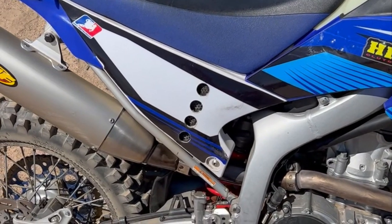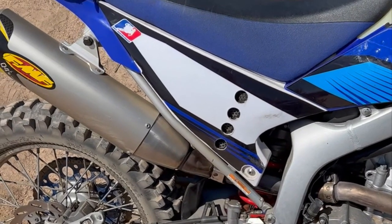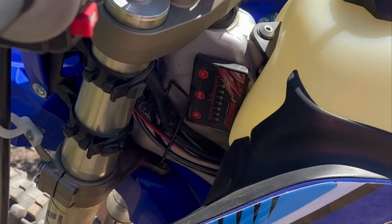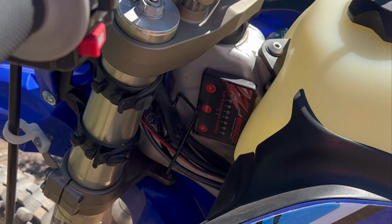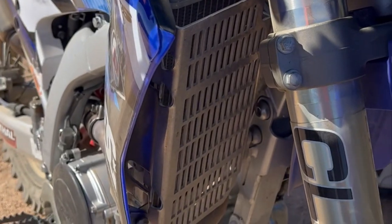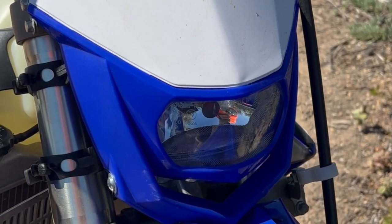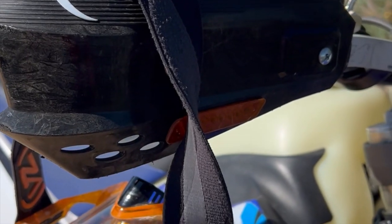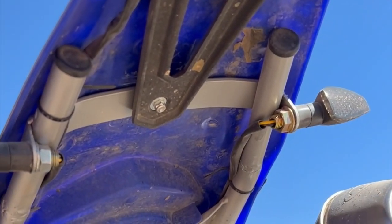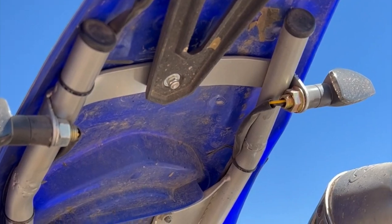Some simple mods gave this bike great power. The airbox flapper was removed and I sealed the hole on top of the box to direct air better. I also drilled out and filtered the holes in the access door for additional airflow. Combined with the fuel injection module, it made the bike truly come alive at every level of the power band. Small things were also added: a radiator guard, LED headlight, LED rear tail light and blinkers, and front LEDs integrated into the hand guards. I also cut every frame tab that was no longer needed and reconstructed the rear fender mounts to lighten the subframe.